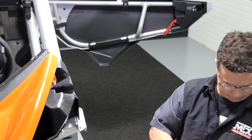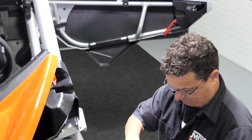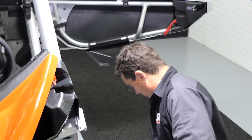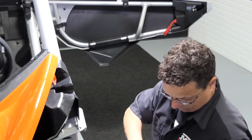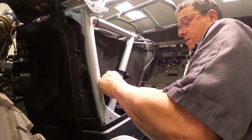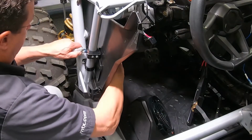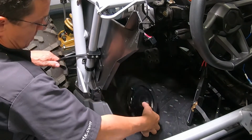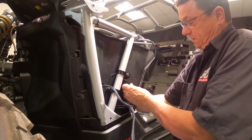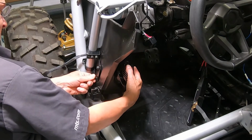Now we take our kick panel and get the wires freed up. I should have brought cutters, but I didn't. All right, grab your last 4 3/4 inch 10mm bolts. You're going to bring this around to the front. Feed your wires through the last remaining hole in the back, like this. Reaching from the inside, you should be able to line up and see the brass inserts from the kick panel.